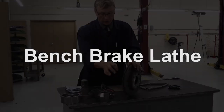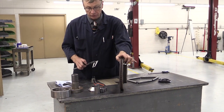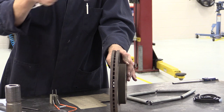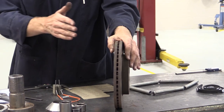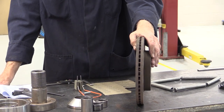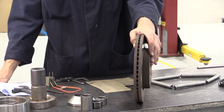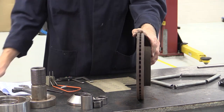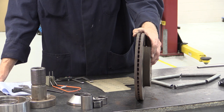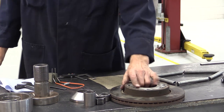The purpose of this video is to show how to resurface a rotor. The most important aspect of determining whether you can resurface a rotor is whether it's thick enough — does it meet the specification? You compare the minimum specification, sometimes referred to as minimum thickness or discard thickness, against the online service system known as ProDemand. You probably want to be about 50 thousandths of an inch — that's .050 — above minimum thickness before you try to resurface. If you're less than 50 or 60 thousandths, don't waste your time; replace the rotor.